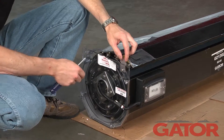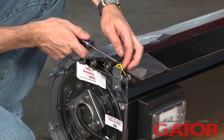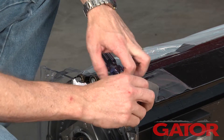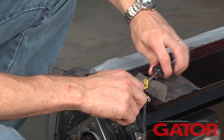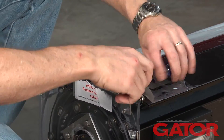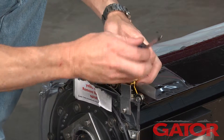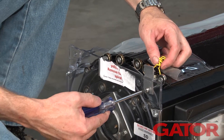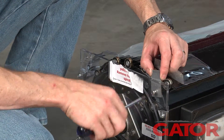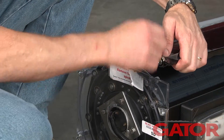Pulling that out. We've also got this bracket that's holding this blanket, keeping it from coming out. I'm going to take a Phillips head screwdriver, run it through this little yellow coil, and undo this coil — spinning enough to where we can pull it off of the ball bearing that it's wrapped around. Then I'm going to take that Phillips head screwdriver and remove this bracket from the housing, remove the screw, and remove the bracket. Now I can remove the coil. We can repeat those same steps on the opposite side.